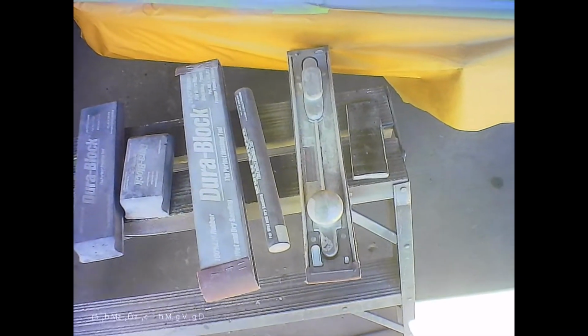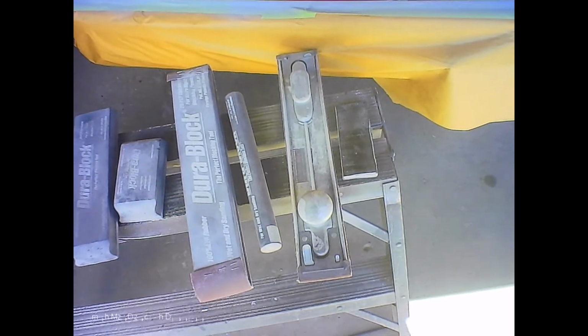But if you were going to buy the stuff that comes from the auto body supply store, they're all pre-cut, with the Velcro or peel and stick and all that kind of stuff. It's expensive. So it's a trick I picked up a couple years ago. I was a cabinet maker in a previous life. So you go to the woodworking section and you pick up sanding belts. They're pretty cheap. Cut them to length, and I just staple them on,